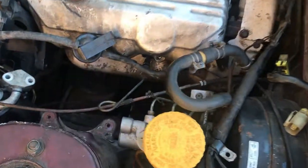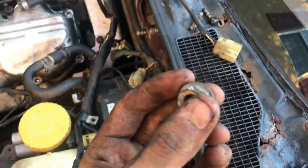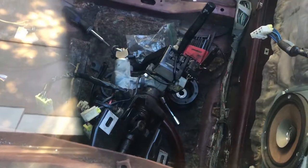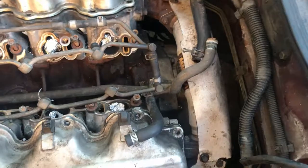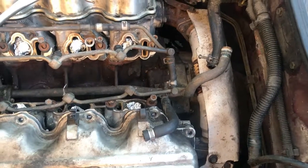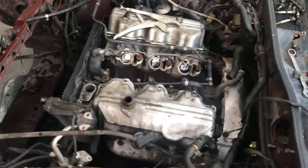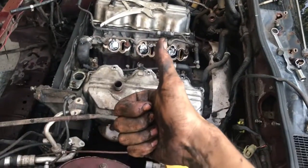There are three bolts that hold the exhaust manifold to the exhaust downpipe. The last one took the longest because you have to move the steering shaft to get to that nut. The other two bolts came out without difficulty, but unfortunately I had to drop the entire steering column just to move it. Finally, I'll be removing the transmission bolts that connect the engine to the transmission — that will be the last thing joining the two together. After about another hour of wrenching, I got all the bolts holding the transmission to the engine and starter off. The next episode will be taking the engine out of the car. Thanks for watching.